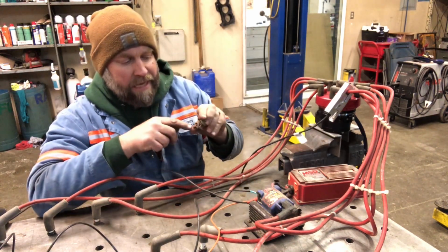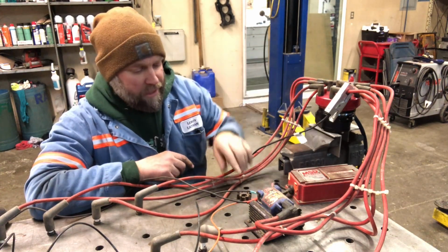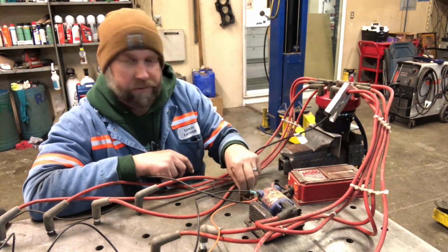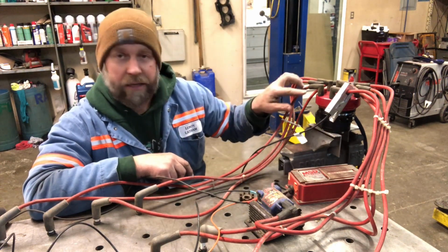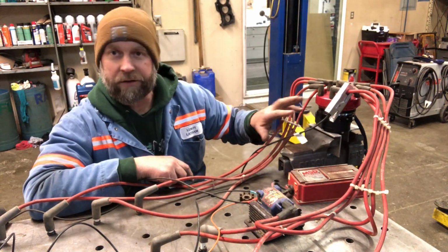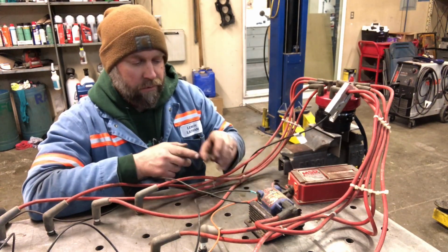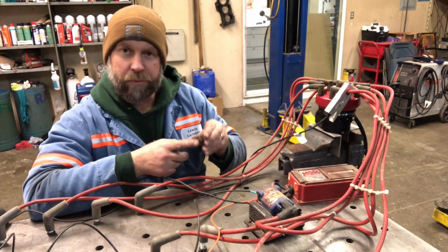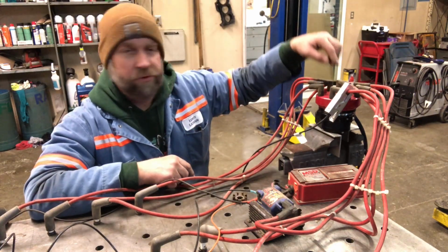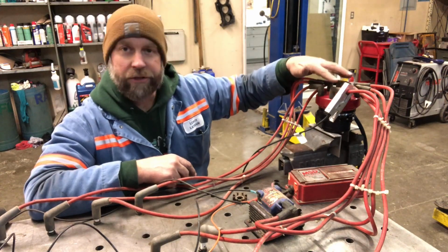And I went ahead and lined the keyway of this wheel up with the keyway on the shaft, but instead of actually putting a key in there to lock it in place, I drilled and tapped one of these wheels and put a small set screw in it to lock it into that shaft. That's all in place, locked in place, and I'm very confident that it won't move. Everything's good there. The thing is, I don't know what relation this wheel has with the pickup that's in this distributor in correlation to the rotor in this pickup, how it fires in relation to the cap.